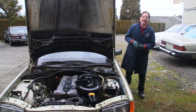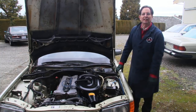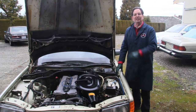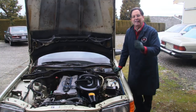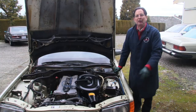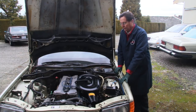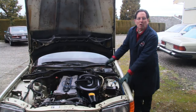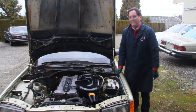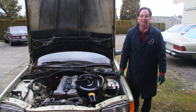What I'm going to do today, since this is really kind of my play car, is get this thing in on the lift and go after it for a full service. That's engine oil, transmission fluid, rear-end fluid, brake fluid, brake hoses, and all those things that probably haven't been changed in quite a while. I'm warming this up now so I can pull it inside to drain the oil. I also have an issue with the oil pan - I'm going to show you that once we get it up on the lift.